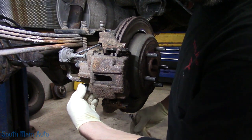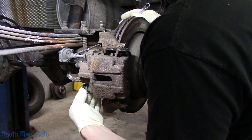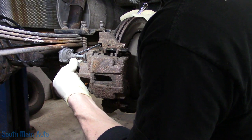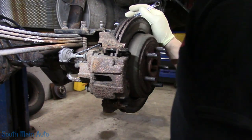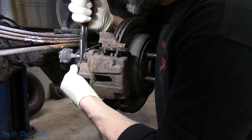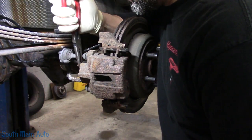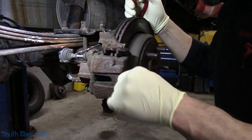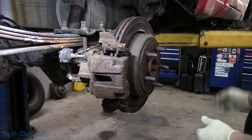I do have ratcheting wrenches before you write that comment — I get that comment a lot. We'll take that bolt out. We'll take our bleeder cover off because we're going to need to reuse that. It's a little crusty on there. That bleeder cover did not help in this case — right full of crust. We'll save that. Usually I douse them down good with fluid film before I stick them back on, or a dab of grease or something like that.